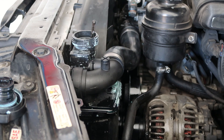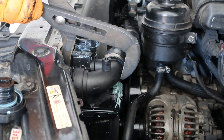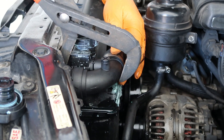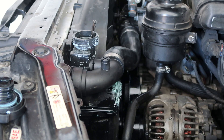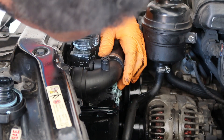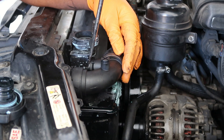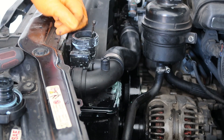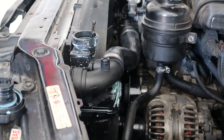I've got some big channel locks, I'm going to drop it all the way back — there it is. That should be in. Testing it — looks like it's in right there, looks in over here, not coming apart. Both clips are in, everything clipped up, everything sealed up, and now I can fill up the coolant and put everything back in. Quite simple, right?